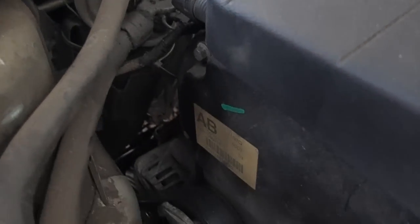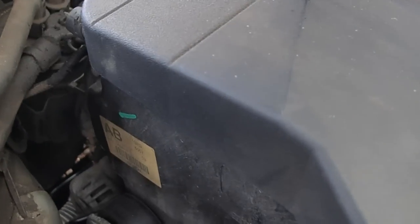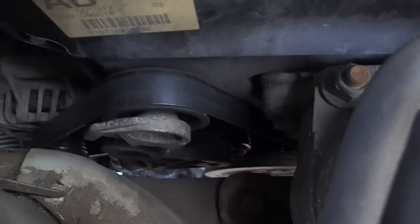Right, so that's the top bolt out of the alternator. I'm still left with the top cable and the tensioning mechanism down here somewhere. I don't know whether you can see down there. Let me try and zoom in. Now, as you can probably see, just coming into focus now, is a little square hole. And that's supposed to be a quarter drive, and you're supposed to get a quarter drive ratchet in there, but you can't get one in the gap there.